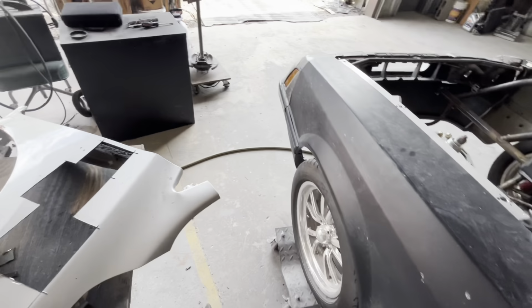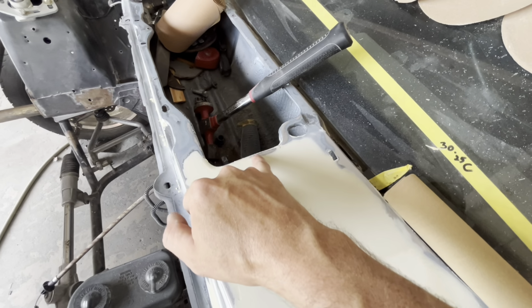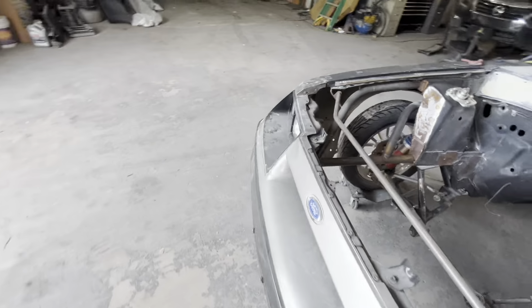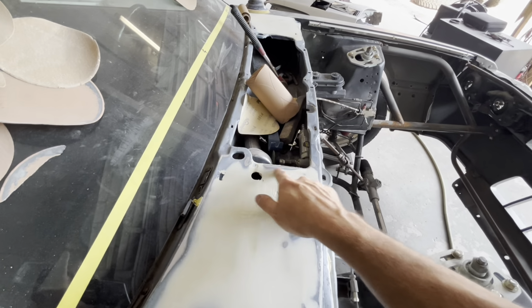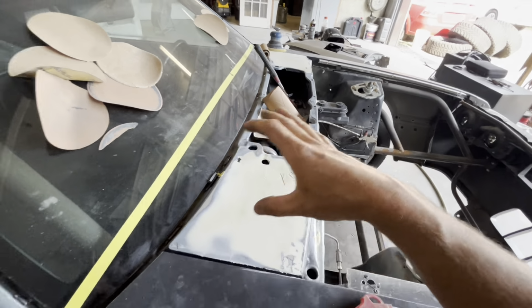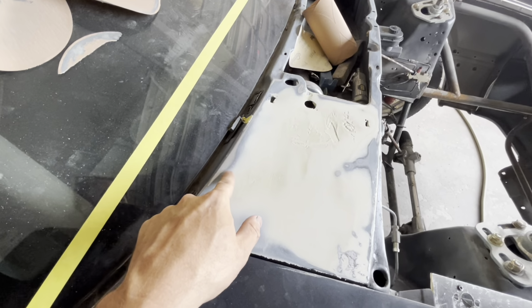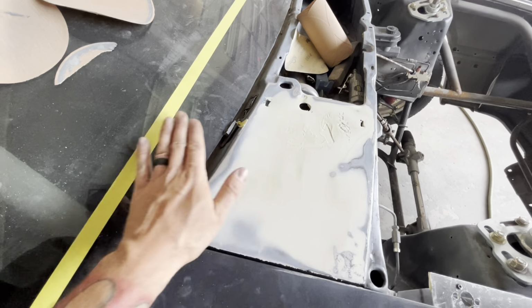I noticed it yesterday when I was sanding that the dead giveaway that I needed to check something was bare metal showing right there, which we went over in other videos. That means it's a high spot. And on this side, when I hit this, all of that metal is hitting. So that's a high spot. It either was curved like this or ramped up like that, and I felt the sander grabbing it. All of this right here is fine because that's cut at the same plane, basically.